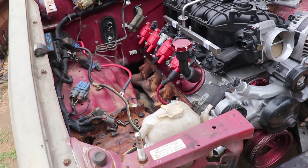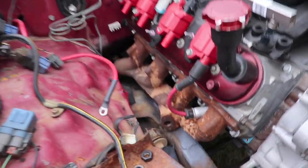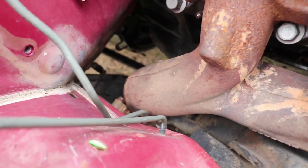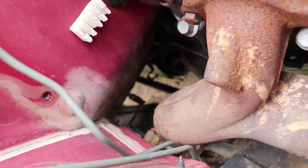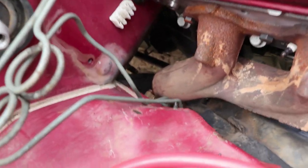That is it. What we've got to work on next, off camera, is getting some exhaust work done. So I chopped off the flanges on the truck manifolds. We're not gonna run turbo. That's gonna be too much trouble and more money than what I wanna spend right now. So we're gonna run our exhaust manifolds, flip them back normal, cut the flanges off.